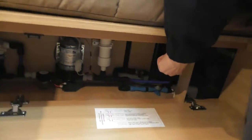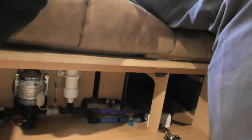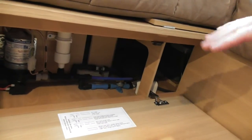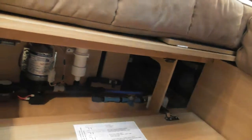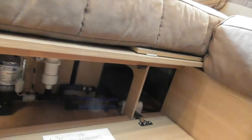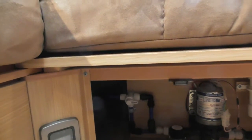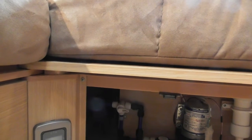There's a yellow drain — that's your boiler drain. See that? Your standard one. And then this side there's a white one. We never did drain it on the other one, but you would just drain that down. All you do is lift that up into the vertical position and it just empties underneath — it just drains down onto the ground outside. There's a white directional valve — if you're going to use the onboard tank, or want to fill from outside, that's going to be in a certain position.